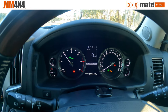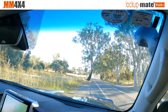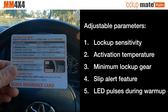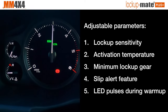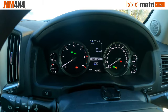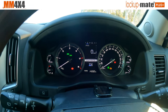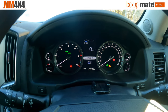Now you're setting parameter number two. The lock up gear — you can set it to lock up in first gear if you've got a modified valve body, the kit supports that. As you push the LED it will cycle through the different settings, you see the number changing there in the middle bottom. And once the kit's set up, it's very much set and forget. You don't have to interact with the settings. Once you've set the kit up, you usually do it once, or you just leave it in the defaults, which is what most people do.